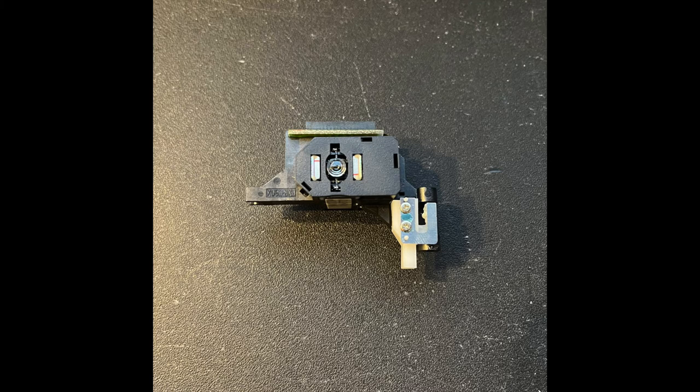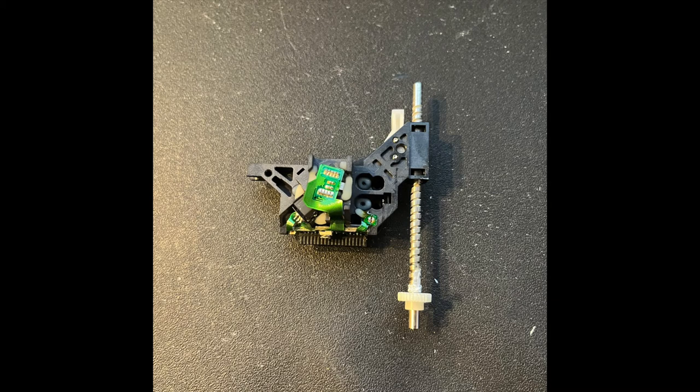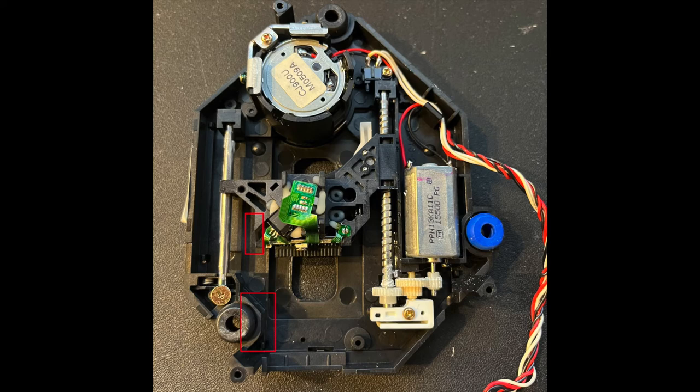Once you've attached the white plastic piece to the new laser, you're ready to reinsert the rail — just rotate it clockwise, making sure the white teeth are making proper contact with the grooves in the rail. Then install the CD-ROM laser back into the GD-ROM enclosure, put the clamp back on and screw it down, and check to see if anything is out of whack. Make sure the gears are connected and turning, and that you can move your laser up and down the rails. I found that two highlighted areas stuck out a little more than the original laser, preventing the new laser from going all the way to the back of the slot — which would prevent it from reading certain games. You may need to trim those highlighted areas with your rotary tool so it goes all the way back just like the original GD-ROM laser.